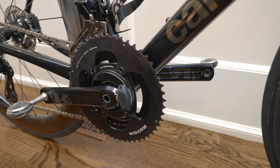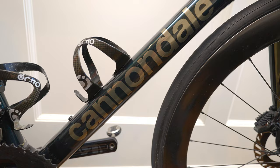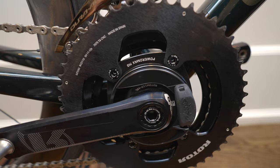The third and last reason I went with the NGeco is that the power meter paired with the Rotor ALDHU cranks cost me $1,190 Canadian all in, which makes them competitive with similar spec'd crank-based power meters. I went with a combo package that has the Power2Max NGeco power meter paired with the Rotor ALDHU 24mm cranks. Since Shimano Dura-Ace cranks are fitted with 24mm axles, this allows me to swap out the Dura-Ace crank with the Rotor crank using the existing Shimano bottom bracket. I could also reuse the Dura-Ace chainrings on the Rotor cranks, if I want.